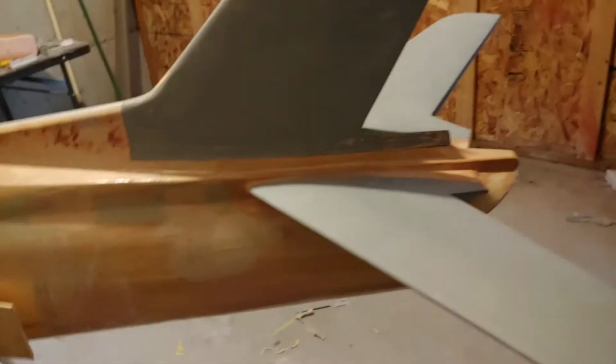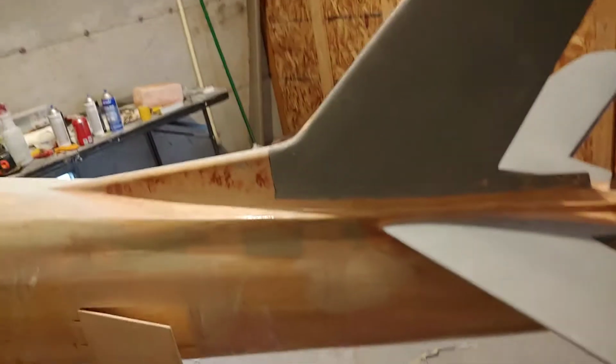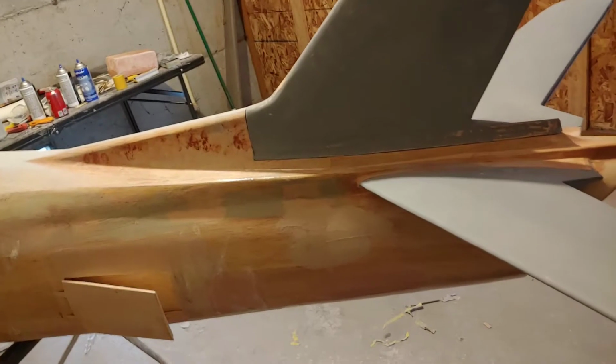So anyway, I've sanded it a little bit here and there, but I'm actually going through, and this is a very messy process. I wanted to show you just what it is before you get it in steps. That's guide coat on there, and I use that to sand out and get these seams looking good. But you can see I got a lot of dust. That's very deceiving. You want to keep this as clean as possible. Little spots like this, little spots like that, they're just going to have to be touched up. Simple as that.